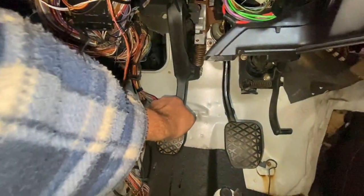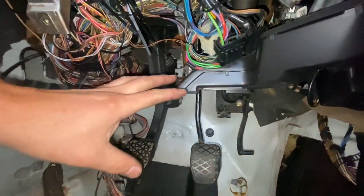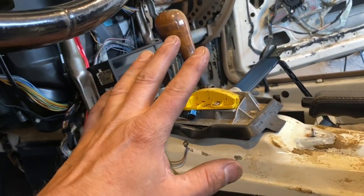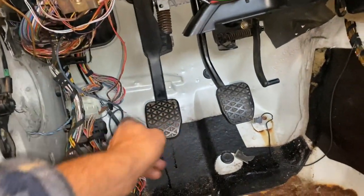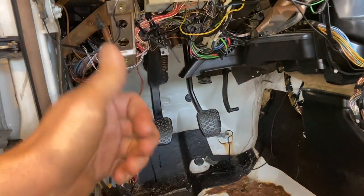The safety neutral switch — where you have to have your clutch pressed in to turn the key — I will cover that in the wiring episode which I'll do later, and there'll be a link in the description. I'm going to do episodes on every single part of converting an automatic to a manual: pedals, shifter knob, putting the transmission in, the clutch, all the torque specs, electrical — I'll cover the safety neutral switch, what you have to do to the computer, wiring up your reverse lights. Make sure you subscribe. Look at that — we got ourselves a clutch pedal and a brake pedal.